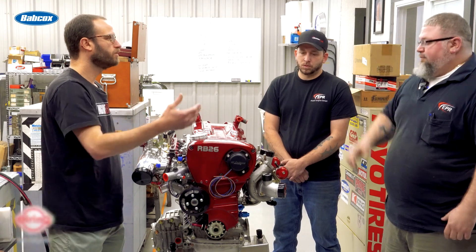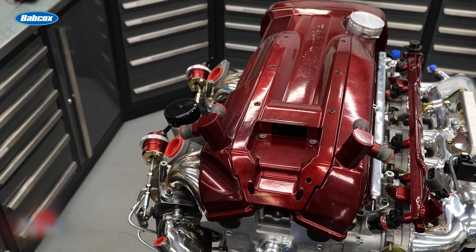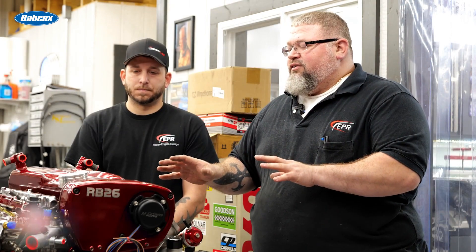You mentioned the coating on the turbo — did you guys use coatings on any other parts in this? We did. We coated the turbine houses on the turbochargers. We also coated the pistons — it has the ceramic anodizing on the piston, as well as the crown coat and skirt coat. The main rod bearings are coated as well, which helps with retaining oil on the bearings for the crankshaft. It also has coated lifters. We did the coated lifters on this because on a lot of solid lifter applications we've noticed a huge difference in how loud the engine is in the valve train, and as soon as you put a coated lifter in there, it immediately softens the whole valve train system. It sounds a lot nicer and it's less intrusive — running something coated completely dampens that out quite a bit.